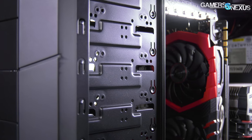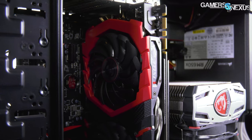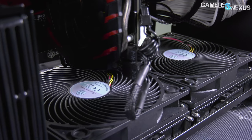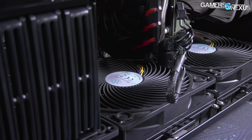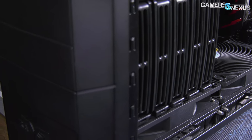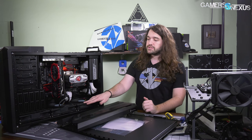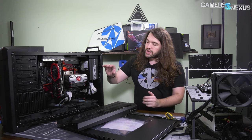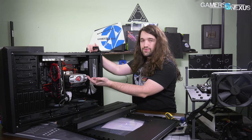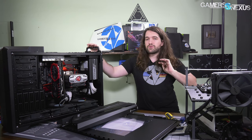The Raven O2 really took a chance with it, and in doing so they were able to elongate the case considerably — it's pretty disproportionately long. That's to accommodate three 180-millimeter fans, which we just recently tested against a couple of 200-millimeter fans and found were among the best performing large fans of the time. You've got three of the best fans of this form factor in a large case that's inverted the layout such that air from the bottom fans goes straight into a tower cooler.